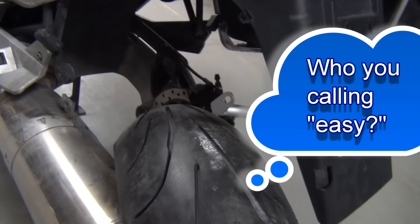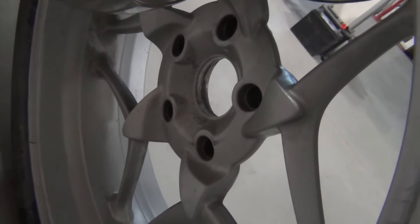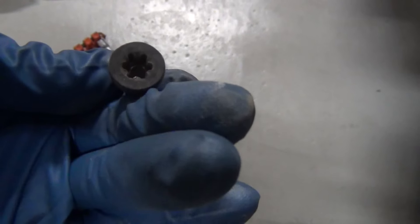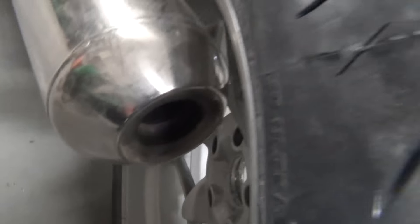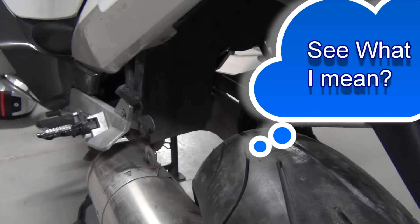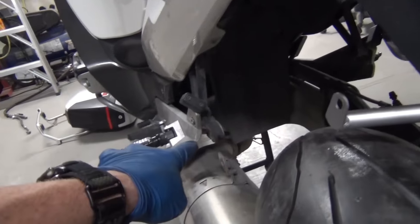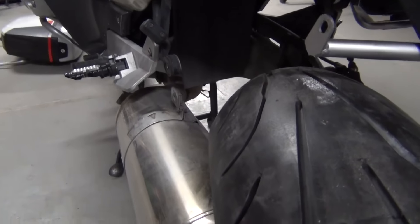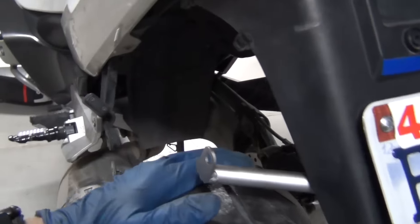So this is how the tire goes in and out. It's really super easy when you look at it — you're like, man, it's gonna be no problem. You just take the wheel bolts. They don't have lug nuts. It's more like a BMW car with these — it's a T50 by the way. But when you go to pull them out, you're like, oh, perfect. But then you can't get it off unless you take off the side panniers and unbolt the exhaust clamp and unbolt the exhaust and kind of move and twist this out of the way. But then you can get it in.